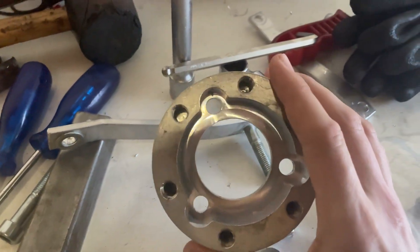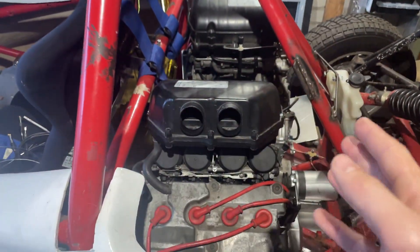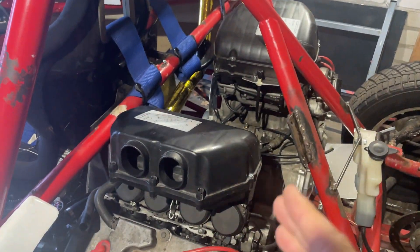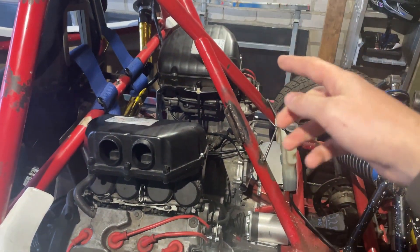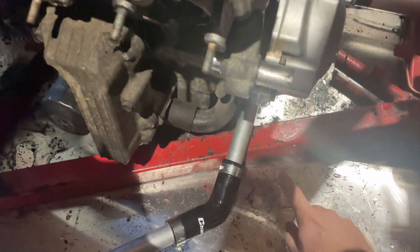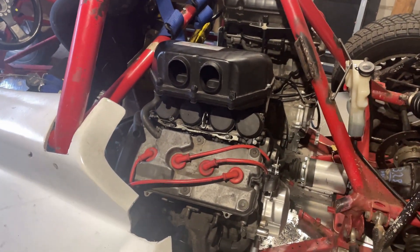The thing is I only changed this aluminium part — this part was on there when it was out of the frame, and with the new one I get the clearance with the frame everywhere. I also cut out the lower frame right here. Now that I know the engine fits with the airbox and everything on there, it's time to get them back out and either reinstall that lower frame or make a custom one, because those two tubes and the cross bracing aren't strong enough. Then we can fabricate the engine mounts using these bushings, with tubes running from here to here.